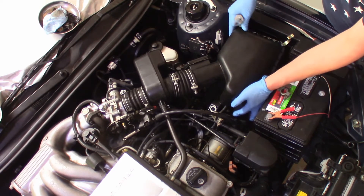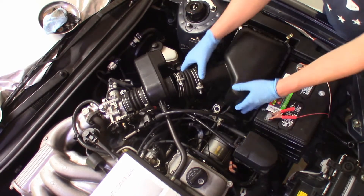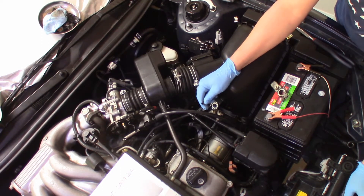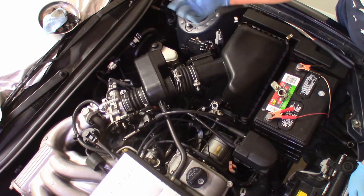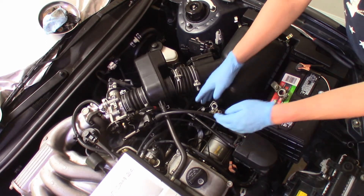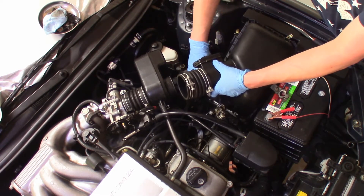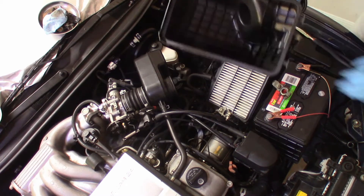You can work your way along and take this off as one assembly. Disconnect all your vacuum hoses and inspect them — make sure they're not cracked. Take the hose to a parts store like O'Reilly's or AutoZone; they have reels of hose you can buy. If they're cracked, it's a good time to replace them. There's also a wire that holds the cables for the cruise control, and another hose at the back of the intake — twist that one off and get things out of the way.